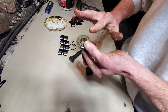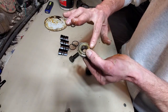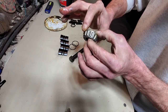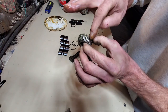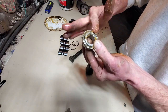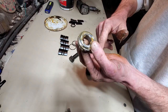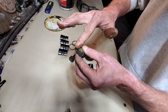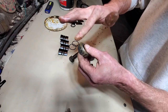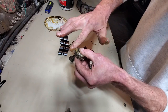I won't spend a lot of time on doing this super proper. This isn't a full duty bearing going in your car. I can also feel the friction when I know I'm getting grease up in the channels. But this is how you do it. You put some grease on and you keep working it in until you have no more grease on you. You're transferring it into the bearing. Just keep working it in like that. I just keep a little bit in the palm of my hand right there, store it. I just keep working it in.